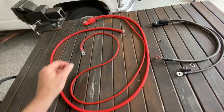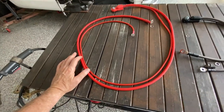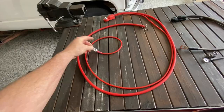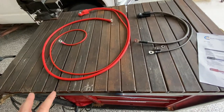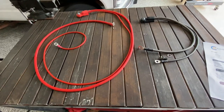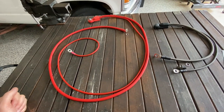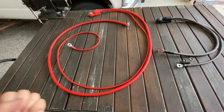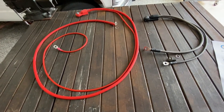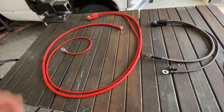You can really adapt them to your situation a lot easier than trying to get one of those stiff cables to work. What made mine a little more expensive is the distance from the battery being on the driver's side and having to go to the passenger side for the starter — my positive battery cables are 66 inches long. It costs a little bit more, but even so, including shipping, the cables ran about $80. That may sound like a lot — you could go to your local auto parts store and for half or maybe a little less try to get something that will work, but they're very stiff, very heavy, hard to contour to your application. These will be a lot easier to install, they look great, and they actually look like they're made for it rather than something you're trying to make fit.